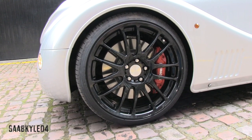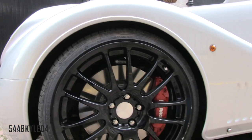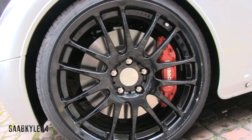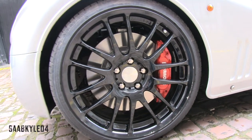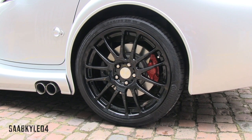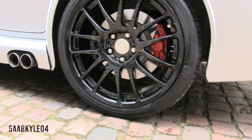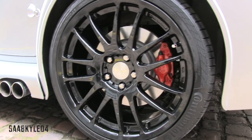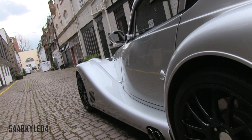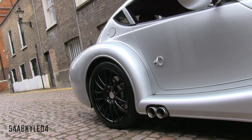The Aero Coupe came standard with a set of 18x8.5-inch alloy wheels, while this example features a set of optional high-gloss black Aeromax style 19-inch 14-spoke forged alloys, manufactured by Ray's Engineering. They're wrapped in 225-35 tires in front and wider 245-35 tires in the rear, able to hold around 0.96g of lateral acceleration. Bringing the car to a stop from 62 miles an hour takes just 117 feet thanks to a four-wheel internally ventilated AP Racing braking system, composed of 13.8-inch discs in front and 13.1-inch discs in the rear, clamped down by 6-piston and 2-piston monoblock calipers respectively. This one features optional red calipers.